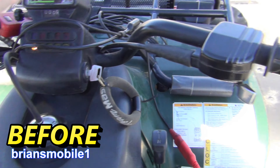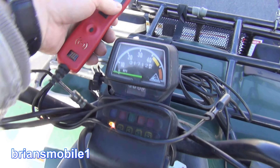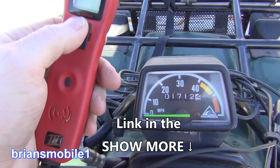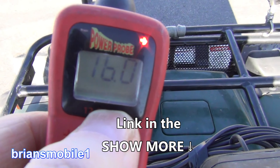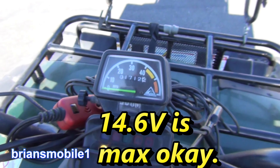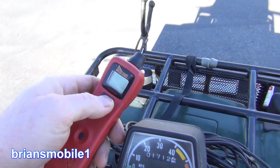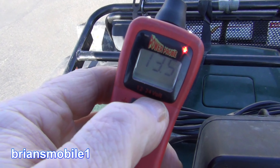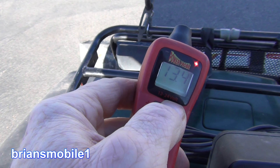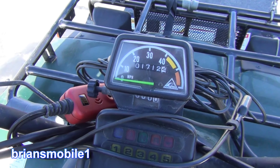So it's okay at idle, but it's starting to just kind of hiccup a little bit, running a little bit rough. I've got it hooked up here with the adapter for 12 volt, and we're at 16 volts. Now when you rev it, it gets up to like 17 volts. If you turn the key off and you don't have it running, we get 13 and a half — which is just a supercharged battery. It looks like the regulator's not working properly.